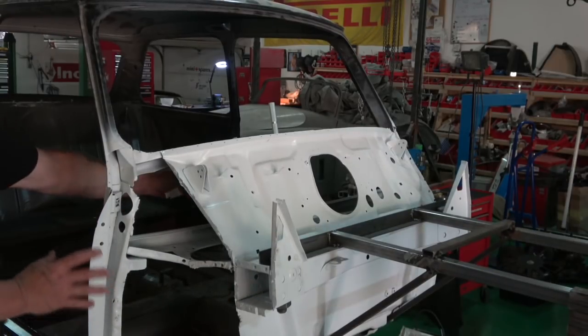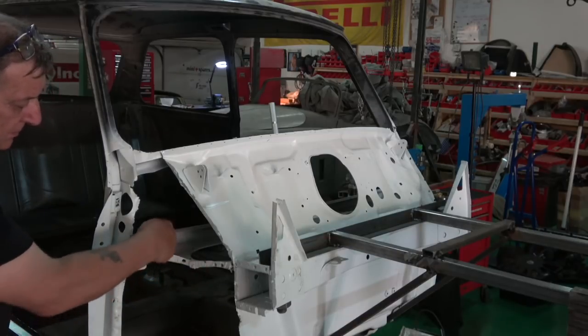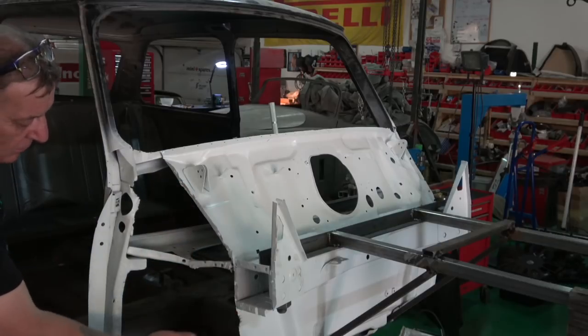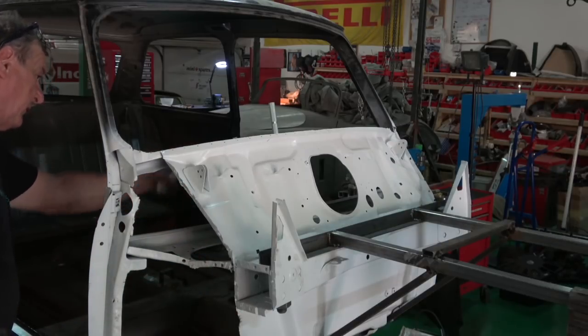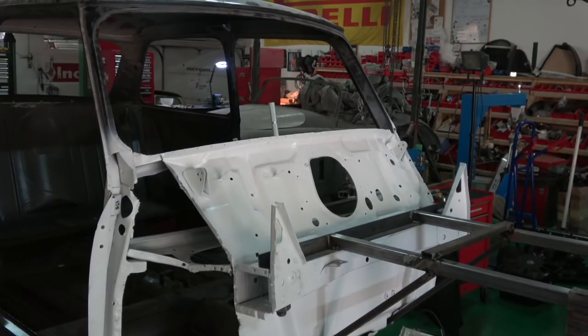So be very careful not to take off both sides at the same time. Even one side could be a problem. I'll come up with some way of solving that, because there's very little strength in this panel across here. That means the whole bulkhead is sitting on about four or five webs. Something to be careful of. I'll lay it down, take the strain, take this out of the way, and rotate it for you. But it's something I'm going to have to work out.